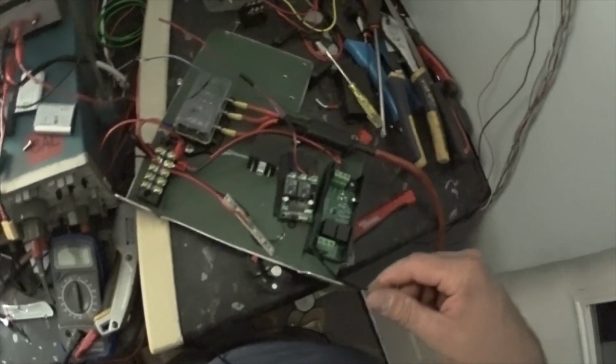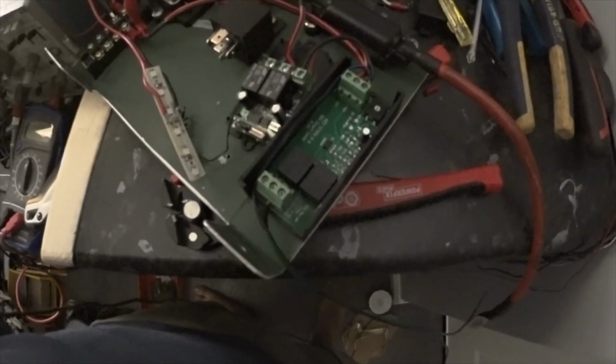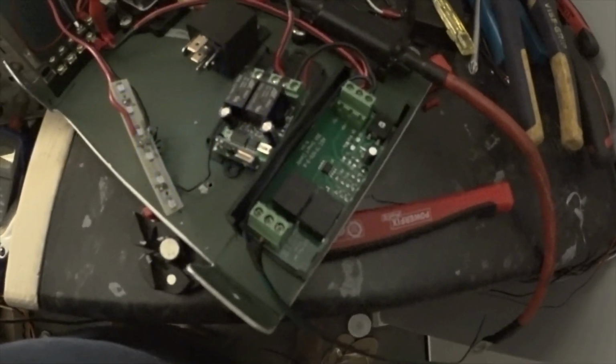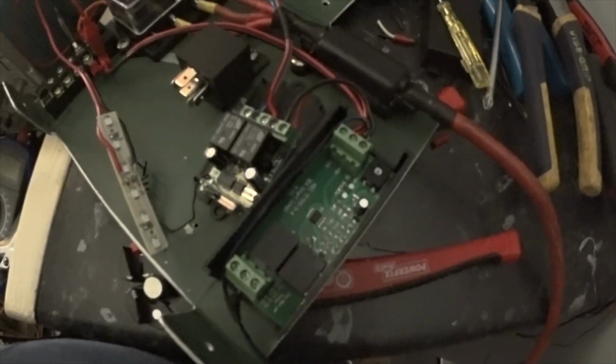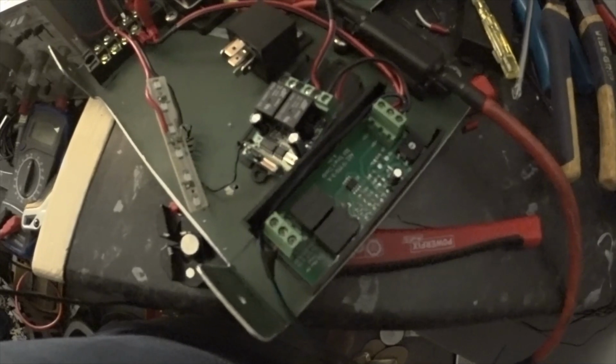So I've just jerry-rigged this up to check it all still works before I button it up, and got a fob up here. So you've got channel B, which is not connected, and channel A is just rigged up on that light for now. And then if we turn the voltage up on here, click, that is clicking in about 13.8, and you can adjust it on that pot there, and it's clicking off. Okay, it's clicking off just below 12.5, so it's not too bad. We'll see what it's like when it's in the car. We don't want it flicking. I set one up a couple years ago that was on a little VSR with a 100 amp solenoid can, and it used to trip on and off. It had no threshold.